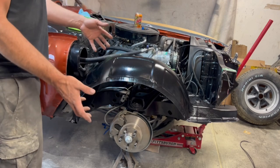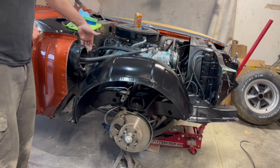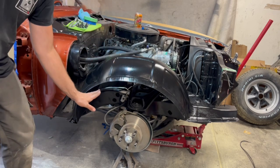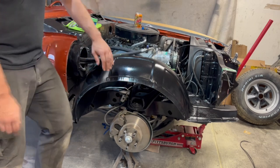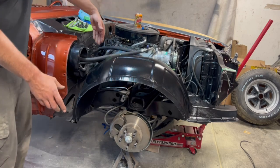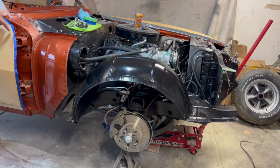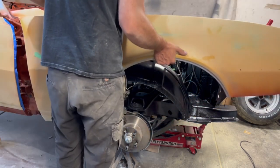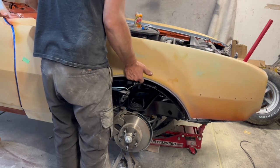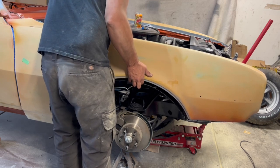I'm going to get ready to grab the fender, but I'm going to show you the idea. What seems to work is — we're going to grab this fender. It has that little part here that has to go around the blower motor housing up against the firewall. So as you bring it in, you're going to kind of hook it in here and slide it back. But the fender also goes on the bottom side of this wheel well, so you kind of got to hook the wheel at the same time. That's probably the reason why you leave it loose — you have a little bit of adjustability and wiggle room until you get the fender installed. I'm going to go ahead and grab that fender — I'll kind of hook it here first, slide it back. The goal is not to bang it off the front edge of this door because this is all bodyworked and ready. This is already painted — last thing you want to do is chip up the paint and damage it. Here we go — I'm going to hook down here by the heater box first and slide it straight back.